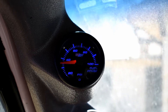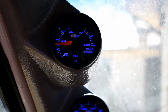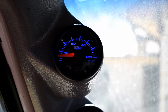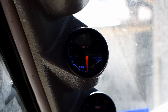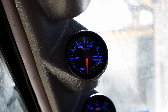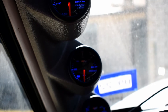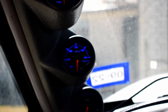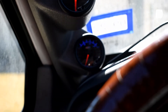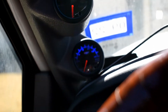There's also a fuel leak at the pump. This is my dad's truck so I just started messing with it - it's got a lot of problems: steering issues and all kinds of other stuff. He's completely replacing the transmission with an ATS Stage 1, so the trans temp gauge does work - I've driven it and it works. Boost is crazy low; he wants to replace the turbo too, probably at the same time as the fuel system since we'll already be tearing all that apart. EGT is reading about 200 degrees right now, but I just turned it on.